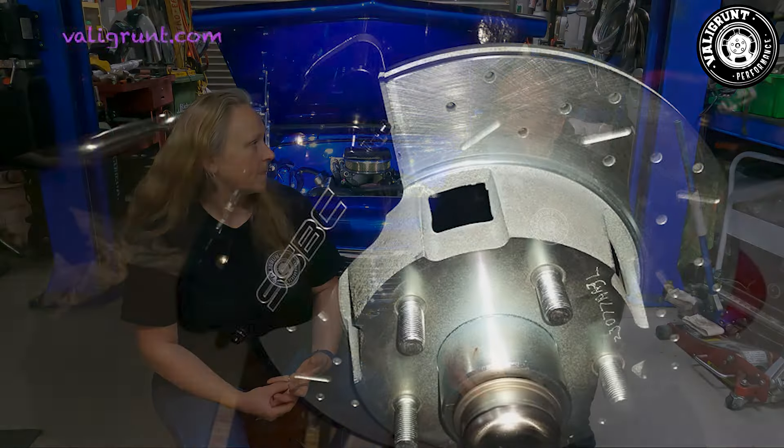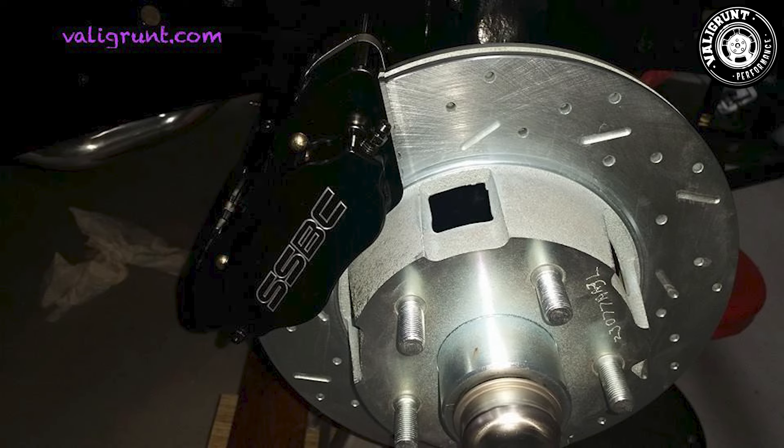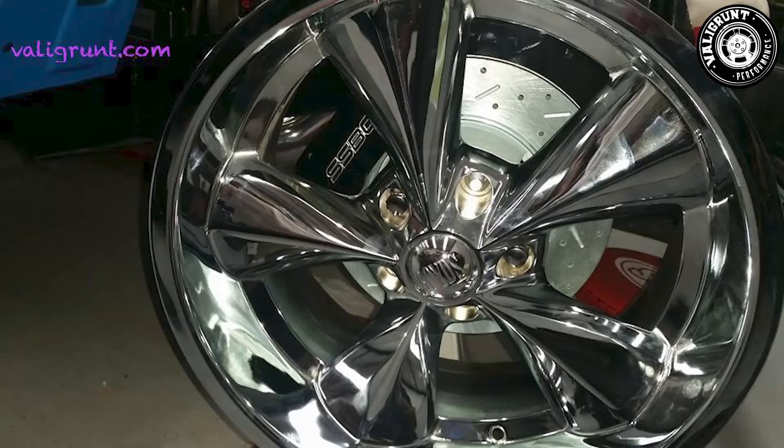So we did a lot of work on the car, both structurally and modifications-wise. He did a lot of research. We did a four-wheel disc combination, some strengthening to the front end, heavy-duty torsion bars, and we did a 383 stroker taken out to 496 cubic inches. Why did we go so big? Because we could — and because anybody who knows Uncle Steve knows he's got two speeds: fast and faster.